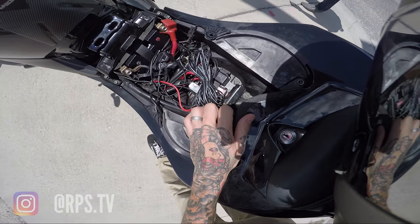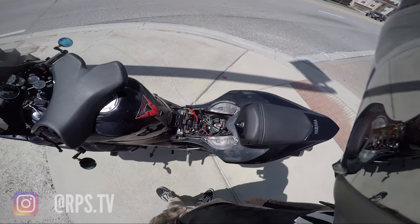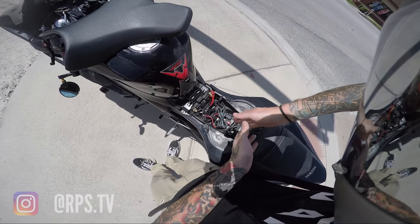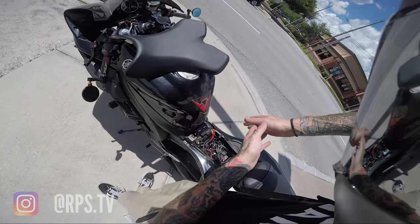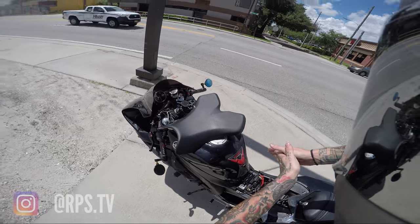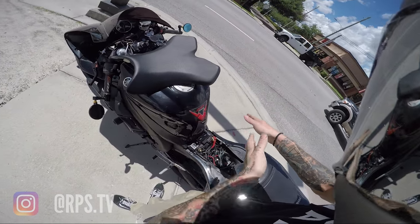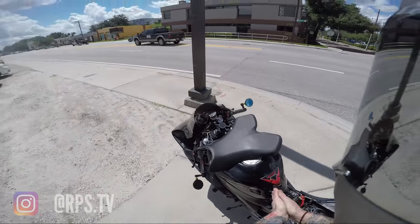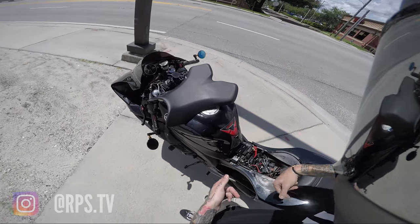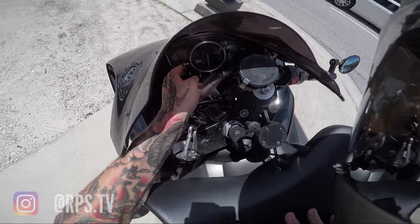It's gonna say 'upright' here, and that is the tilt sensor — it sits right in here, bolted in on a little rubber mount so it moves with your bike. The tilt sensor essentially has a pendulum swinging inside, and what happens is it stays on the axis of the bike because it's hanging with gravity. So when you come into a tight turn and lean, it leans with you because gravity swings at the same pivot as the bike. When your bike stops moving and it's still sideways because it falls — or you get into a wreck — that sensor, instead of staying with you, drops with gravity and hits the sidewalls, connects with magnets, creates a connection, and goes from one volt to four volts. When that four volts goes through the system, it recognizes the bike is tilted and cuts the engine off.